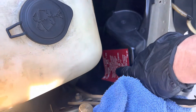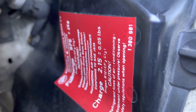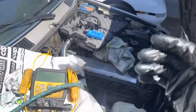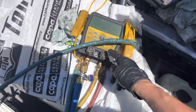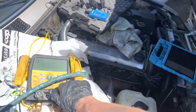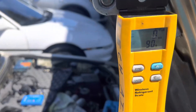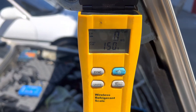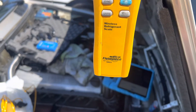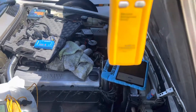The can is 975 grams and I'm only gonna put 900 grams in, so I don't care if I'm plus or minus 10 or 20 grams. Let's open it up — we're at zero about. Open. Now our refrigerant is going into the system because all I want to do is do a leak check one more time with refrigerant in it after the compressor is running.